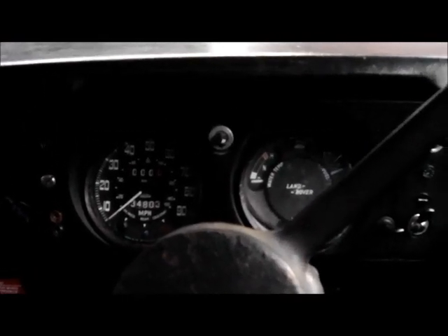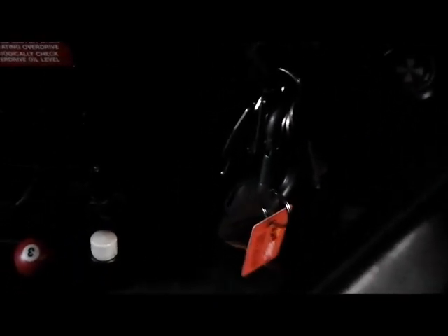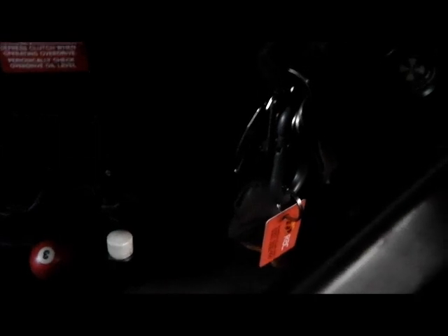I can already hear the difference in the front — just with it ticking over you can hear the roof starting to vibrate; put my hand on it and it stops a bit. But yeah, noticeably quieter. The other thing I've checked is to see that I can engage gears without crunching, because the floor mat is quite thick. Clutch pedal down — reverse is the best test — in without any crunching. Not quite happy with that yet though.